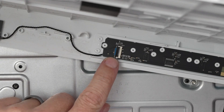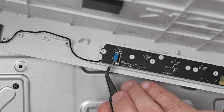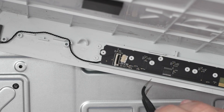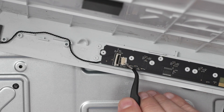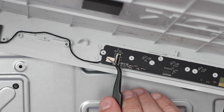There is a ribbon cable — and that ribbon cable is torn right there. That's going to be a problem. One of the problems we're going to have here is if this ribbon cable is different than what I find on the regular Xbox One console, it's going to be tough to find this ribbon cable because I can't just find a part from one of the regular retail consoles. So that could be a major problem.